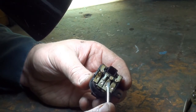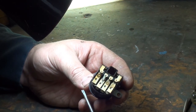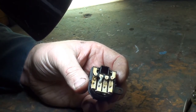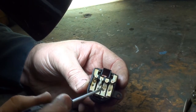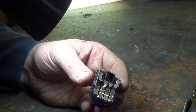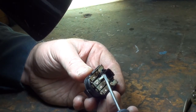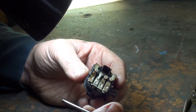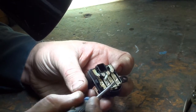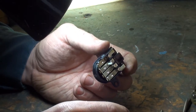into the contact. Or if you had a low battery, say if you had a low battery and he's trying to crank it, you create a lot of heat. And since there isn't a relay, you have these heavy contacts in this ignition switch, which means you also see the heavy gauge wire running all the way back to the ignition switch. We'll get to that later. But there's going to be a lot of heat generated here if you have too much current draw. So somewhere along the line there was too much current creating heat at this contact, which melted that terminal down.